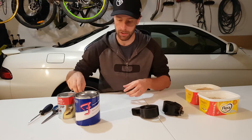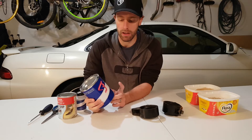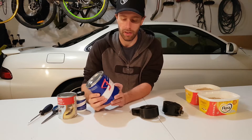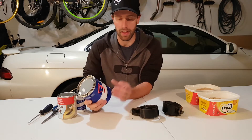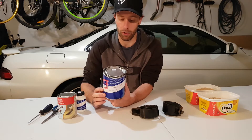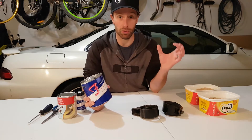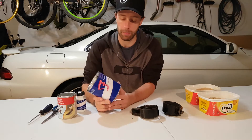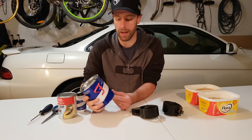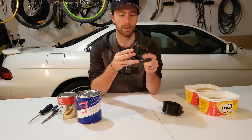The polyurethane comes in different thicknesses. If anybody was into skateboarding or longboarding, you would have seen the durometer rating of the wheels — they come in like 65, 75, things like that — and that's basically how hard the plastic is. We've got 94A, which is a really hard plastic, and they recommend this for racing applications because it doesn't absorb much of the vibrations. It's really firm but still has a tiny bit of give so the engine doesn't crack on its mount. Most skateboard wheels are around the 74 mark, and the stock compound for these is really low — like in the 60s or 50s.